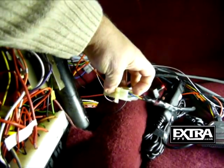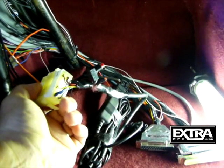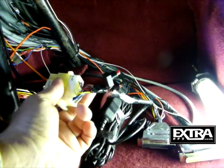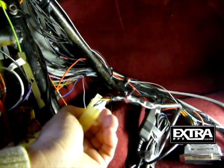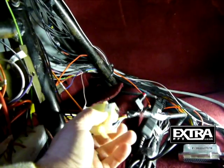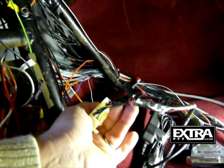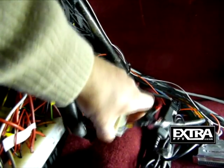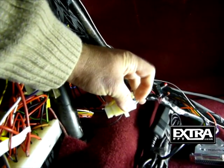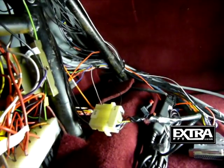On the Innovate LC1 there's a blue wire, which looks like the main ground — that will be the heater ground. I've also got a green and a white wire. Some of the Innovate units only have a white and blue, or a blue and green — it varies by model. Some only have one signal wire, but this one has two.